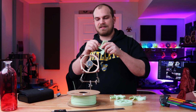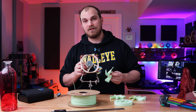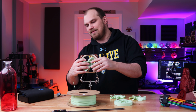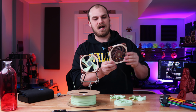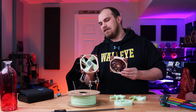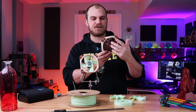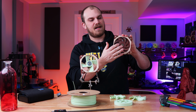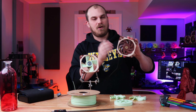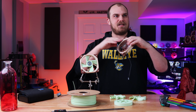In this setup, this is the frame that the fan goes in. These spokes that hold the motor are the stationary thing that the blade passes to create that sound. Normally, if you look at this Noctua fan, the spokes are angled backwards compared to the rotation of the fan disc, and the blades are swept forward. That means that when the fan crosses a spoke, only a little piece of the blade crosses at any given time, making the sound not as pronounced.